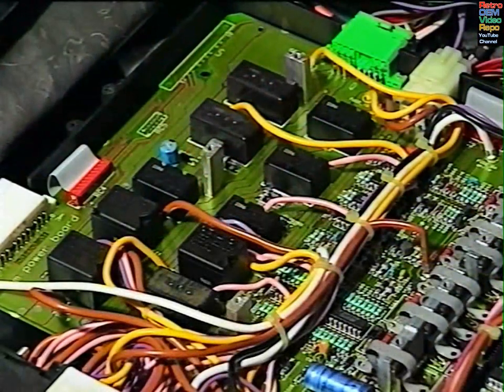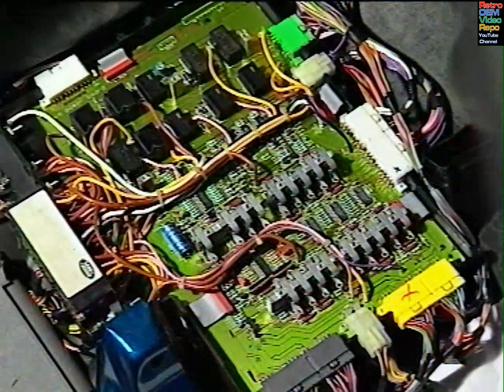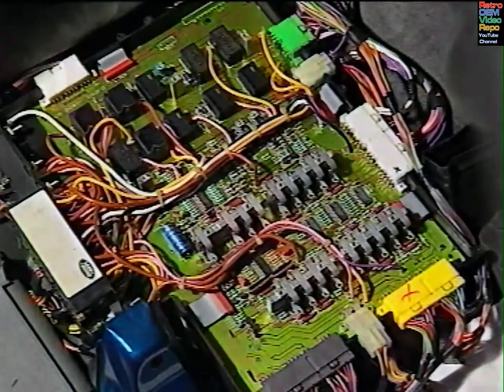So first, let's look at how the BeCM works. While it may seem complicated, in reality the BeCM merely combines many of the ECUs and relays. By removing the divisions between all the systems, they're able to share functions and resources. It also allows a considerable reduction in wiring.